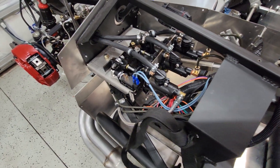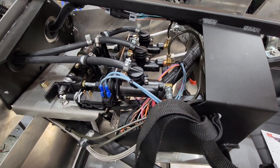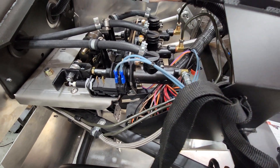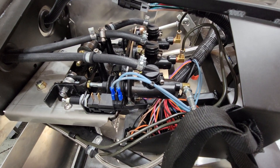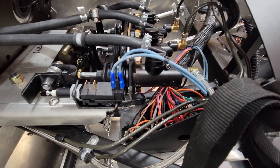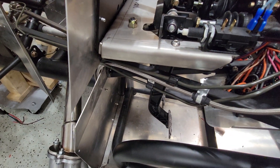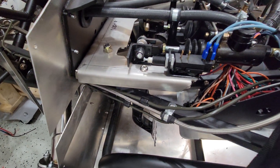I changed the master cylinder for the clutch. When I got it running, I think the issue was the clutch sweep was basically the entire friction zone — because the master cylinder was smaller than the slave cylinder down by the transmission. This one is one-and-an-eighth inches now. If you know anything about hydraulic theory, now that it's a lot bigger than the cylinder below, the clutch pedal barely has to move to get the entire sweep of the friction zone. The first half of the pedal sweep is all clutch, and the second half is dead air — I like it like that.